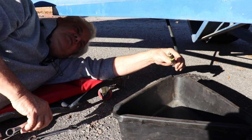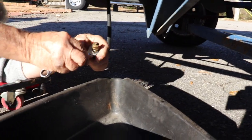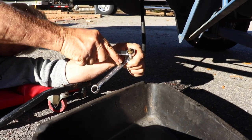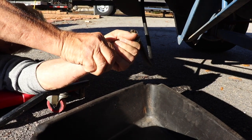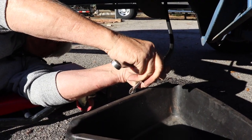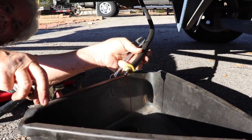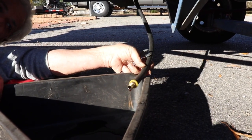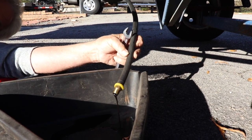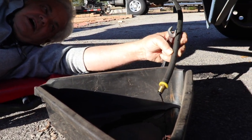We've got our hose fed through the bottom of the boat. Now we're going to take this cap off the oil drain — it takes a 9/16 inch wrench to hold the fitting that goes into the hose, and a 5/8 inch wrench to get the cap off. We've got the cap loose, so now we're going to pull it. The oil should drain out — sometimes this process can take a while, it usually drains real slow. That's normal, so we'll come back to this after the oil is drained.